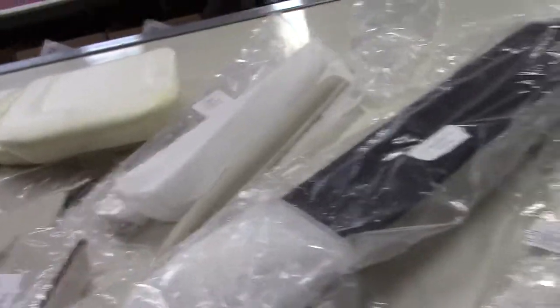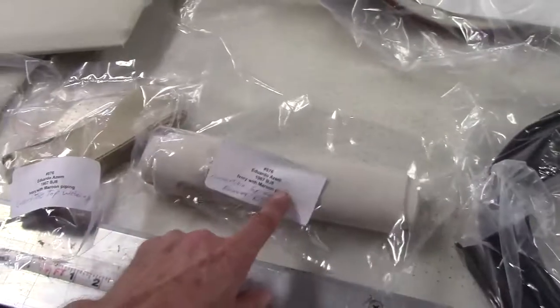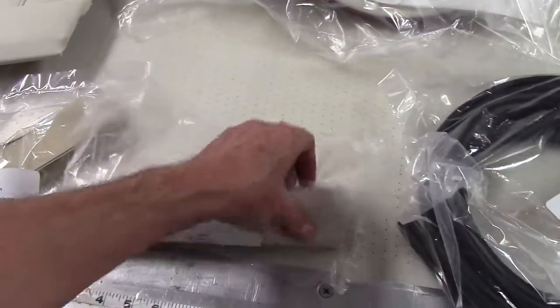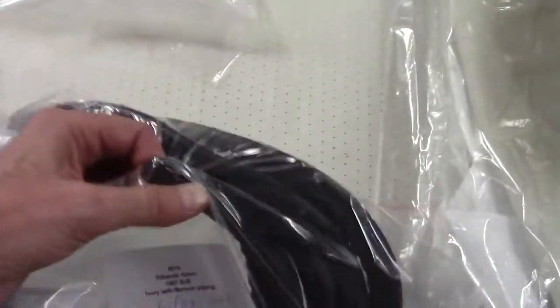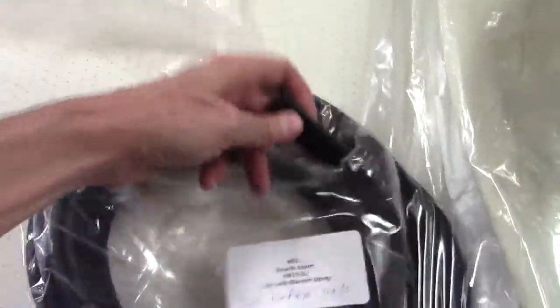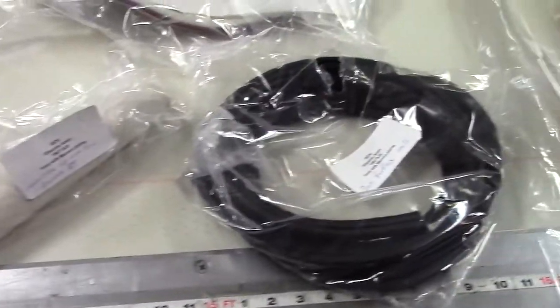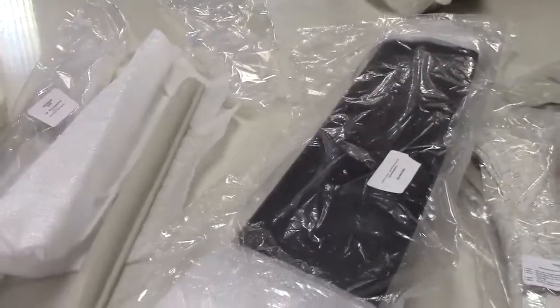Some extras: there's webbing that goes between the convertible top bows, and a kit covering the wood tack strips around the convertible top — four pieces always in parchment color, as the factory used. Another extra is the door aperture flex seal, which snaps on with a fuzzy rubber extrusion — not included in the panel kit but available.